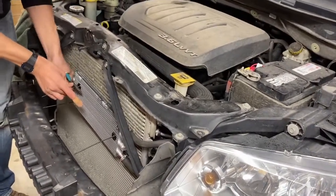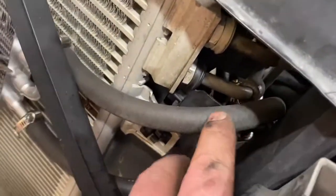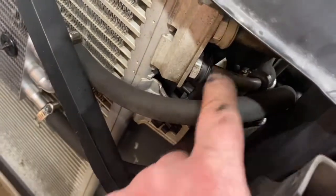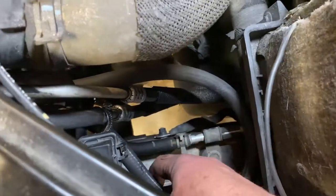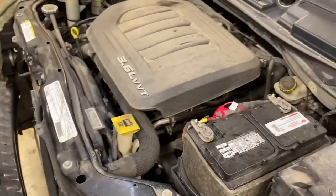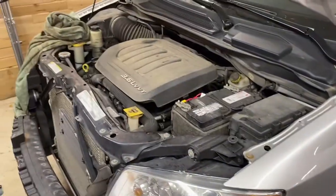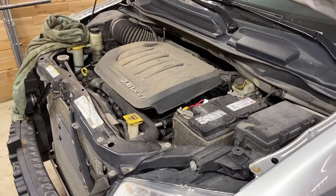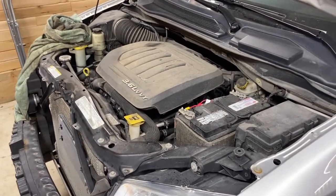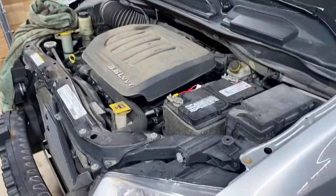We have a finished product. Dallas is snipping the ends of those off. The two coolant lines go through the firewall — the bottom one comes back out here, and the top one continues on. We were able to tuck this loop so there are no tight radiuses in there that could cause it to collapse, and everything's nice and loose with plenty of room, not rubbing on anything. Should be great. We'll check the transmission fluid level, reassemble the front grill, bumper, and everything, and we should be good to go. Hope it goes well for you too. Thanks for watching — subscribe, hit the notification bell, and have a great night.